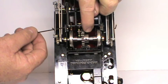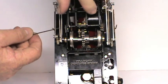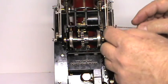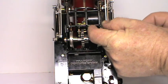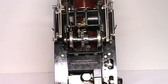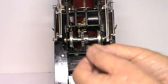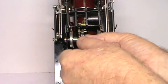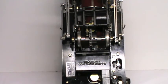To achieve the correct chain tension, hold the slow-mo forward in the engine — not a lot of force, we don't want the chain too tight. Then push the clamp plate back at the same time, and while holding those in position, do up the socket head bolt. Hold the slow-mo forward, push the slotted clamp plate back, and do up the bolt. That gives a pretty good adjustment on the chain — a small amount of rattle and not too tight. When happy with the sprocket adjustment, nip up the grub screw in the sprocket. So it's now time for a test run.